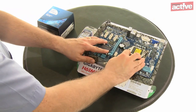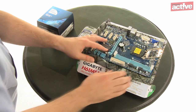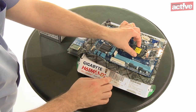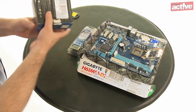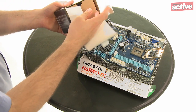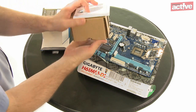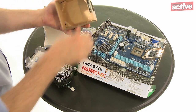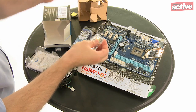Open the latch over the CPU socket on the motherboard and lift up the cover. Remove the plastic cap fitted over the socket. The connecting pins for Intel chips are on the motherboard and they're very small and fragile, so be careful not to bend them with any uneven movement — lift the cap straight up. Open the processor packaging and carefully remove the heatsink, place it to one side and you'll now be able to access the processor itself, which is inside some small plastic packaging.